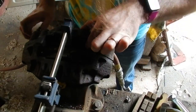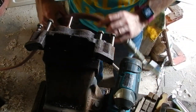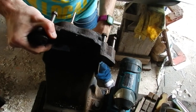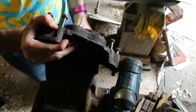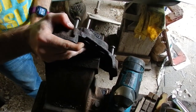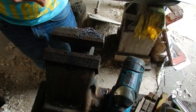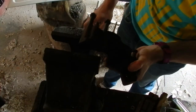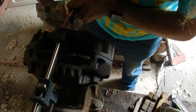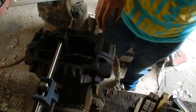I think that's doing more. The way this is going to go, I'm going to have to keep taking this apart, pressing these pistons back in, and then pushing them back out with air — hopefully getting them freed up. They'll move more than a sixteenth of an inch; they're not moving a whole lot, but they are moving, so that's progress. That's popped out again.